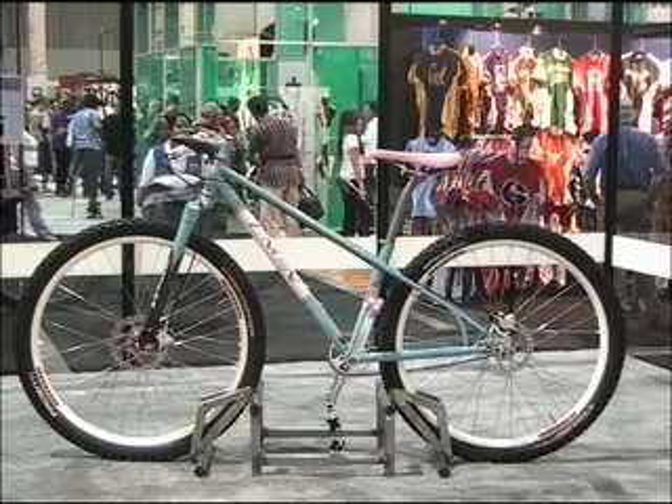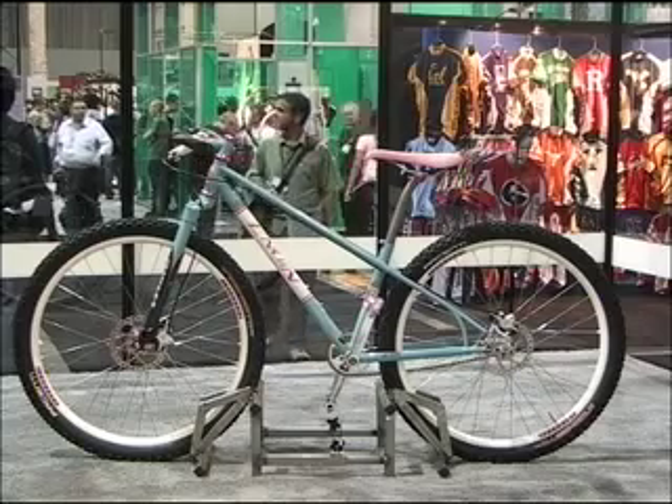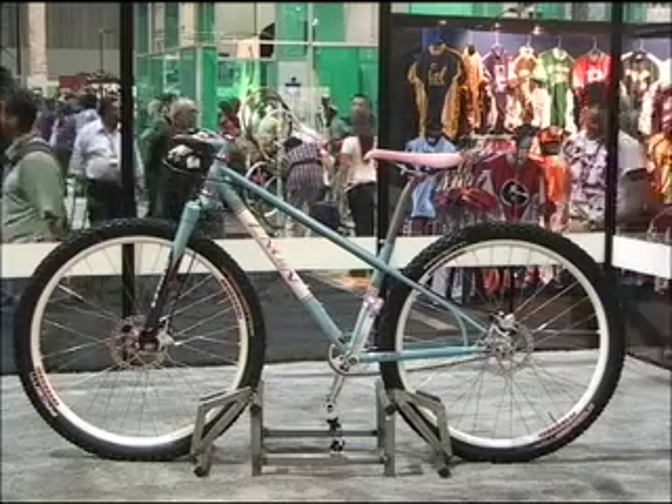It's little. It's hard to tell at first glance that the wheels are any different size — it looks like a 29er. You almost have to see all of them lined up in a row to see the difference. Do you have any production frames? No, everyone is done per order. This is actually only the third bike I've built without a specific end user in mind. We have enough female customers around 5'2" and 5'3" that I was able to base the negative drop stem, stem length, and 170 crank arms on. Everything should be a good fit for a 5'2" to 5'4" rider who wants a shorter top tube length, which is more common for women.